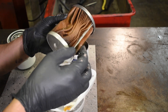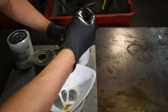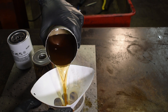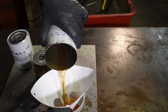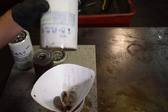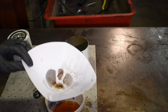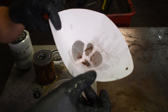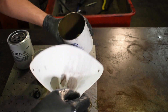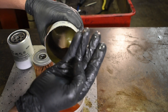Like I said, this is after only 5,000 miles. Inside here there's a little spring — you can take that out — and we'll pour the coolant that's left in this thing into this paint filter. Take a look at that. That's what's clogging up your oil coolers. A little hard to see, but inside here it's absolutely full.